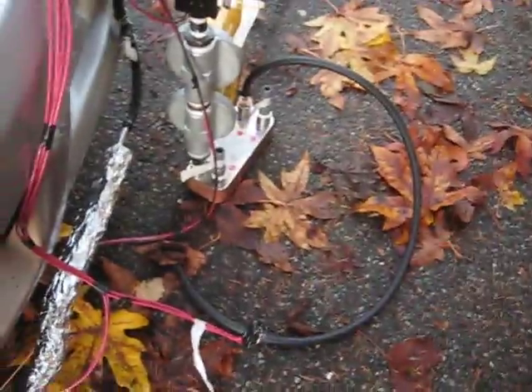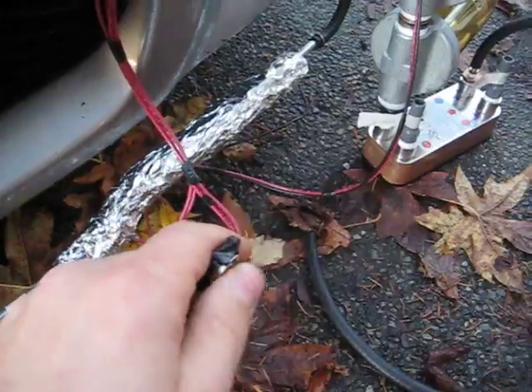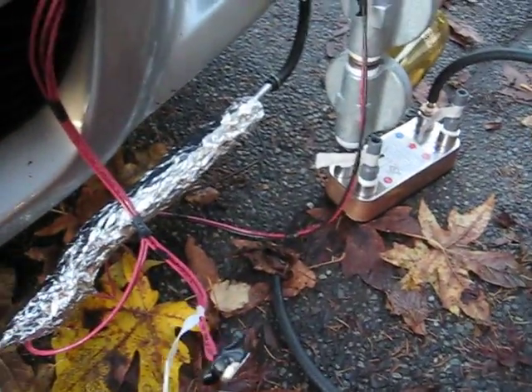You hear that click, and see that light turned off? So now we're still running vegetable oil — the solenoid light's still on, but the heater's off. That's just the temperature safety device, so you don't overheat the system. Sometimes in really low flow, it could overheat, so you definitely want to make sure that works.